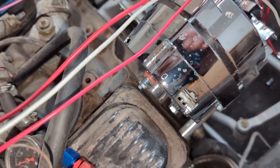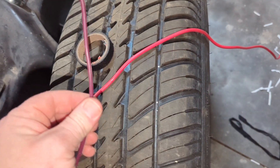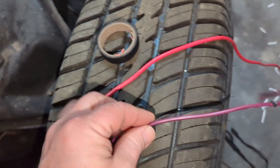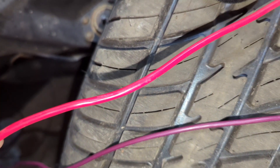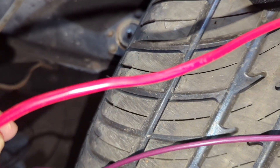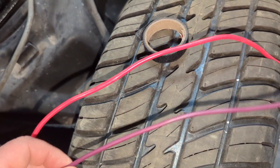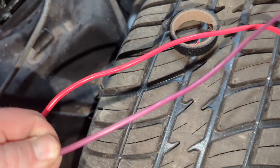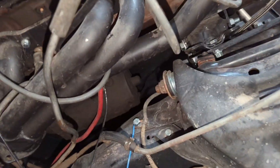I think this is the alternator exciter, the alternator to the battery. And I don't remember what the other red one is — it might be a choke cable. But these are pretty well marked. It says solenoid power right there. And this one I think is the ignition — something, the starter. And I'll wire that right down in there.